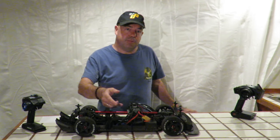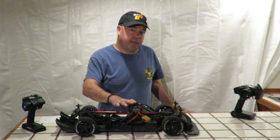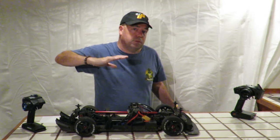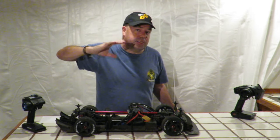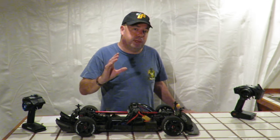Lastly, the cap pack from JJ Customs. It handles up to 12S — we've got an 8S setup on here. It just smooths out that ripple at the top end, stops the car hesitating at full throttle, and gives you that extra 5–10 miles per hour of punch.